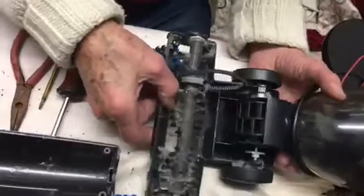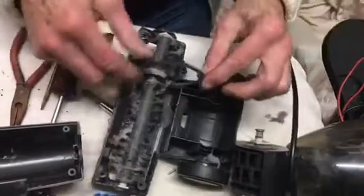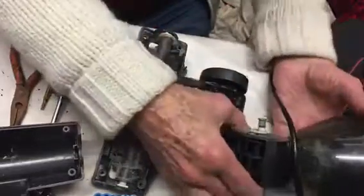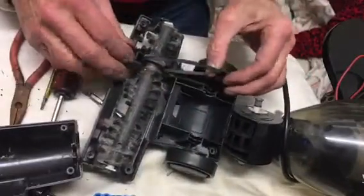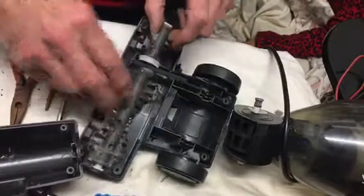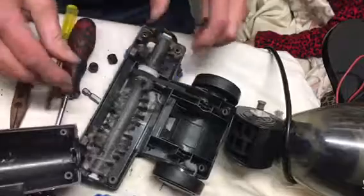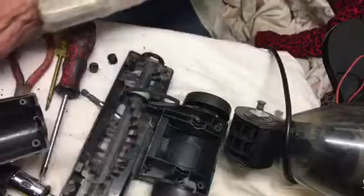Take that belt off. Let's have a look at this. Well, there's the drive belt, which is driven by the motor there — but that is not a motor, that's a turbine. So it's not going to take a great deal to stop that from rotating. This agitator brush is a bit stiff in here, and it's important that we clean this out properly, otherwise it won't work.